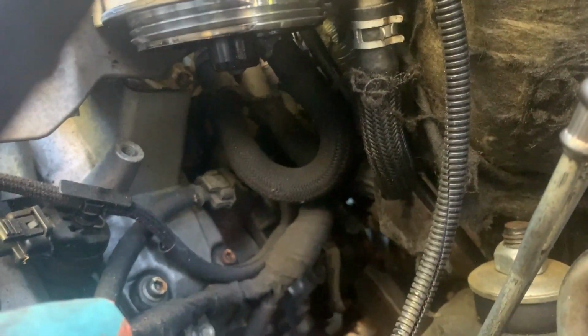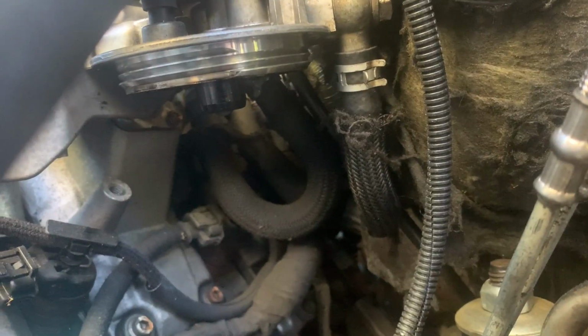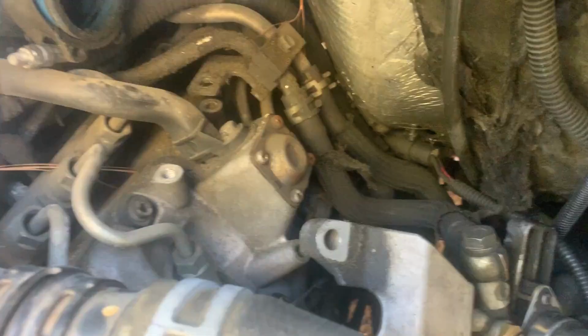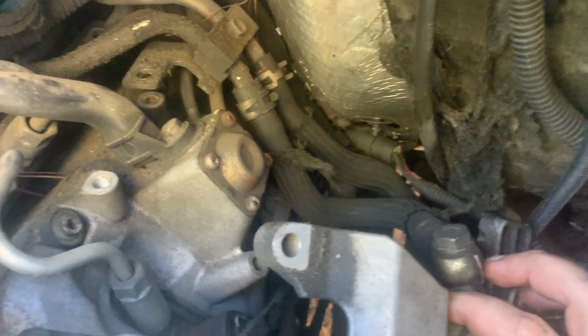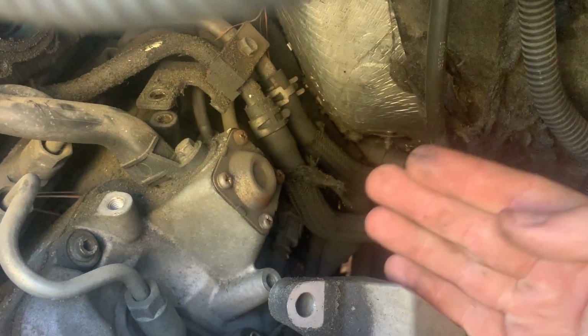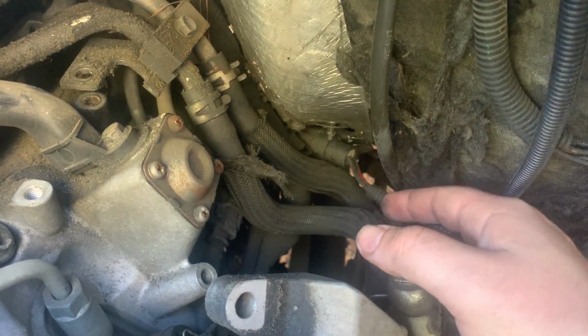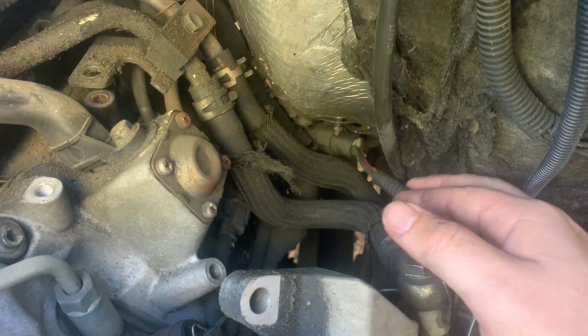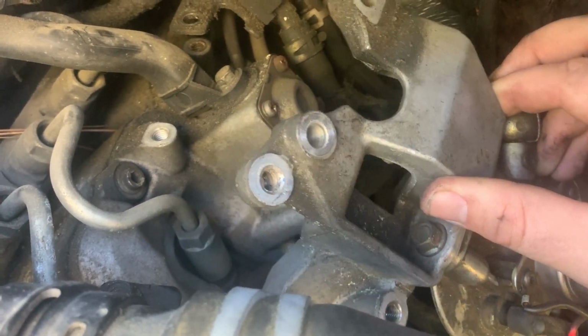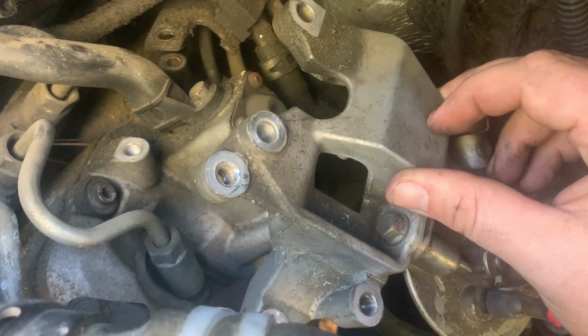Let's look down here. You see the 2 hoses that are gonna have to be cut or the clamp come off with it. Be prepared for those. And then there's obviously gonna be that one connector for the wiring. Somewhere back there's a harness for the wiring as well. We got it loose, as you see here. The other end is just 2 hoses here, so if I can disconnect those 2, this should be completely free. And we got this one wire harness right here that once these hoses are off, this should be easy to access. But this is only held on by 2 bolts. So there's a lot of bolts here, but only 2 of them actually mount it to the truck.